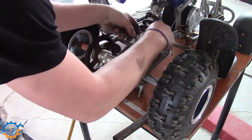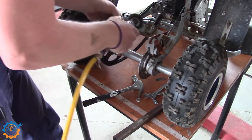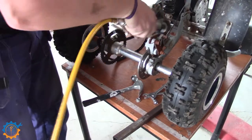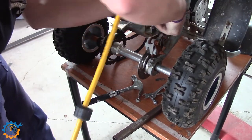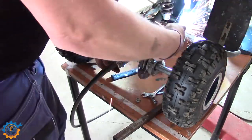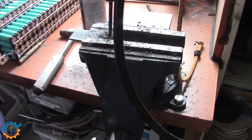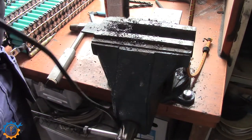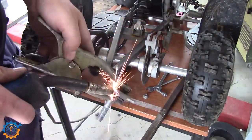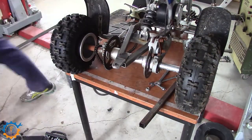The hitch to the ATV is a little bit special because the rear axle is moving. So I'm actually attaching it to the A-frame for the rear axle. I start by removing all the paint, because otherwise you won't be able to weld to it. I took two pieces and I'm just making up a hitch, using several flat iron pieces welded together to get it somewhat strengthened.